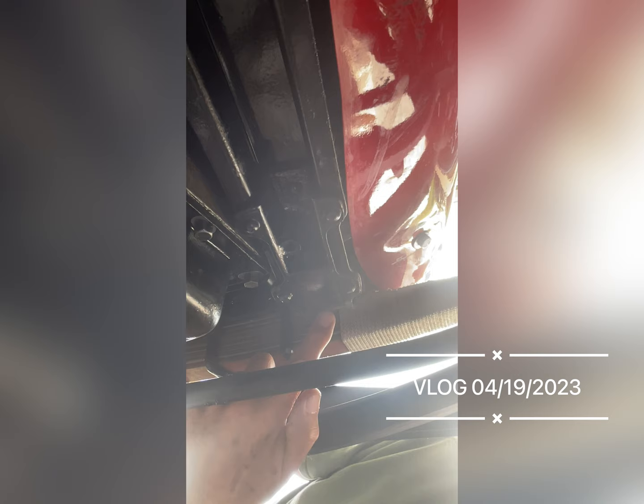Let's have a look at the picture of the chassis where I've welded this piece in. Where I've got my finger, you can see there's a plate welded into the chassis here, into the gooseneck, and it goes right up and round into where the spring is bolted to the chassis. That makes a huge difference to the stiffness. The big problem with boxing the chassis in is that it only goes as far as the cross members, then it twists as well when you weld it — it's hopeless — and you can't get the nuts and bolts in anyway. Welding a plate in there is the best way to solve that particular problem.